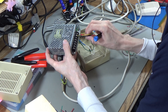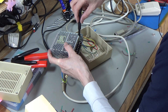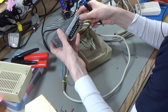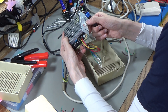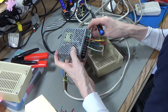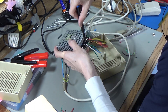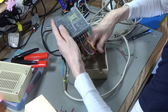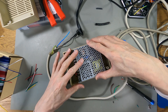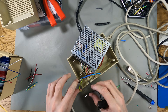Five volts — the power supply is red. Commodore did change the colors of these cables periodically, so don't trust any color on their cables. White was minus 12 — what is minus 12 on here? V3 is minus 12, and plus V2 is the plus 12 volts — I've used a green cable for that because it came out as brown. So that's the Amiga side connected up. Hopefully they'll just sit down there. Now I've just got to connect up the mains part — live first.